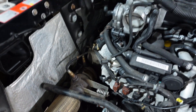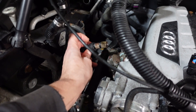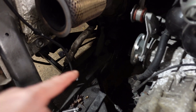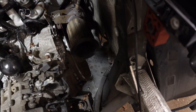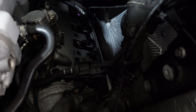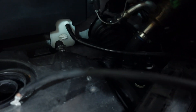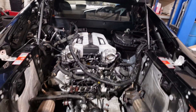The other power steering line is tucked up behind the boot strut. Fuel line is disconnected. The wiring is bundled across from the left-hand side. There's a PCV breather valve to get rid of, and I'll probably move the header tank. The main thing left is the big wiring loom - you can see where it goes into the bulkhead right there, that big electrical line going into the front of the car. That's our next step. I'll just put it up in the air and double check everything underneath first.